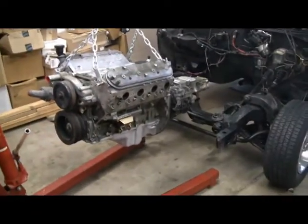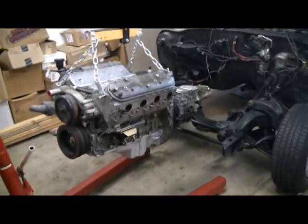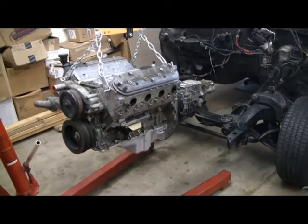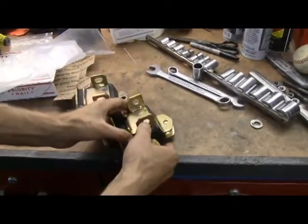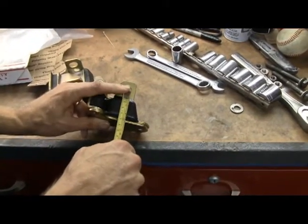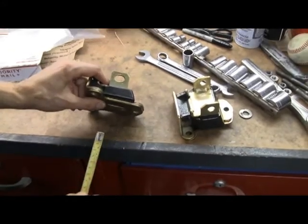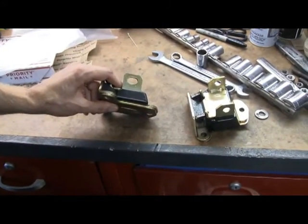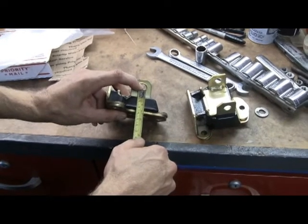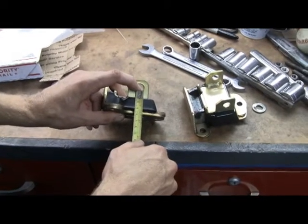Okay, we tried putting the motor back in. I picked up about an eighth of an inch bringing the front of the motor down, which is not enough. So we're going to try those other mounts. From the back of the bottom of the hole to the back of the plate on the current mounts it's about two inches. These are the old mounts I took off because I wanted to boost the engine up to have clearance on the crossmember with the old pan — but with the new pan I should have more clearance. On the old mounts it's inch and a half, so we should be able to drop the motor a half inch.